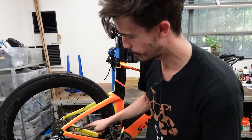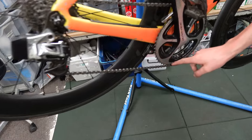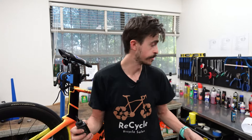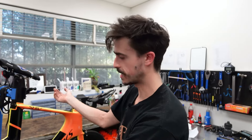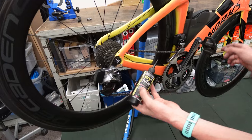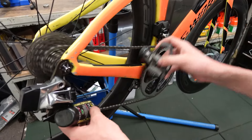Serafina asked whether to put the lube on the top or the bottom of the chain. I like to put it on the bottom, because that way it touches the chain ring and cassette on the inside. If you put it on the top, it's on the outside and not contacting all the other parts. I hold my fist up against the derailleur with the bottle upside down and get one full revolution of the chain — it's as simple as that.